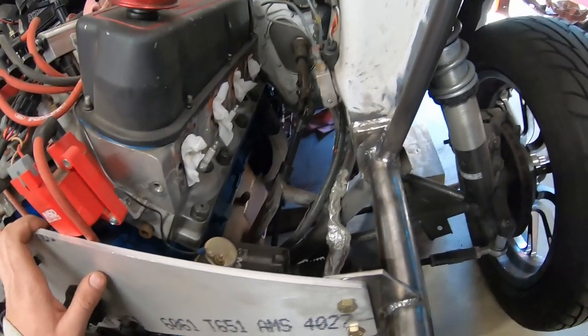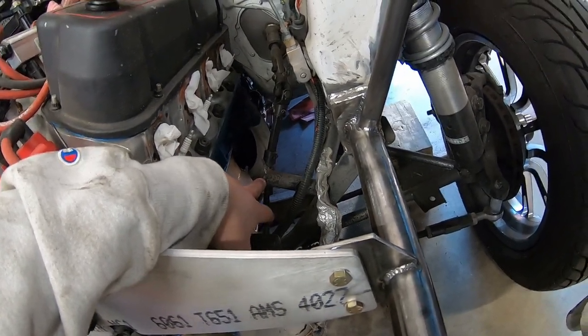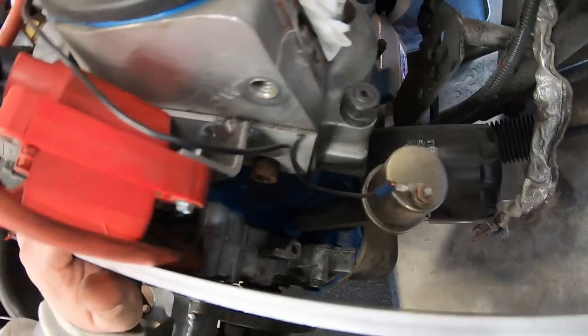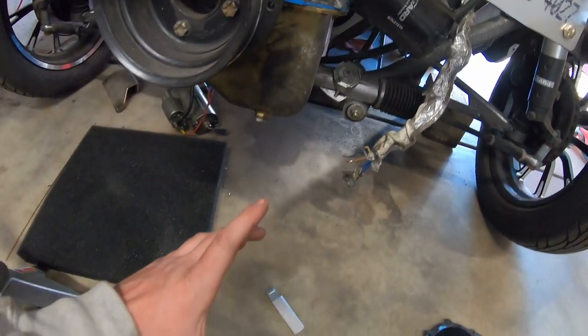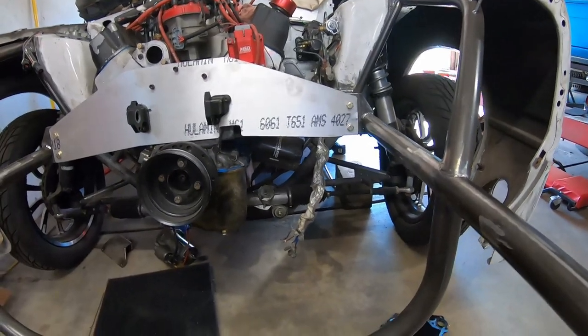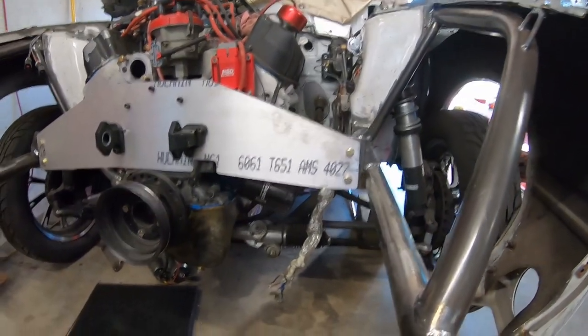I took the motor mounts out obviously. I'm getting ready to make a set of headers — I'm pretty sure I'm going to cut this off and get an oil filter relocator kit, move the oil filter back in there where it normally should go. I just have that stock bar attached still, but I'm gonna move the oil filter — get a little relocation kit, probably mount it down here or up here somewhere out of the way. That way I can make a hopefully cool set of long tubes.